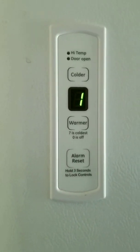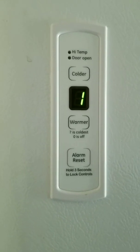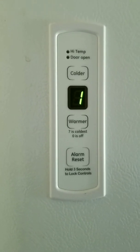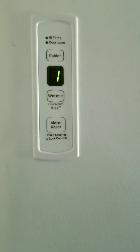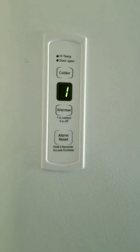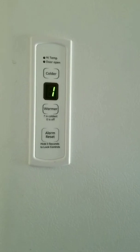Normally, over the years — this one's about 10 years old — I would run this freezer at about level 3 or 4 out of 7, and I would get a temperature somewhere around 0 to minus 10 degrees. But currently it's running colder than that; I'm seeing minus 15, sometimes even minus 20, and it doesn't seem to matter what setting I use. This video is about how to test the thermistor, which is one of the few parts that could be causing the problem.